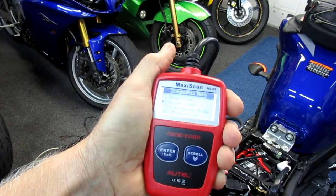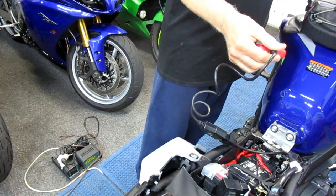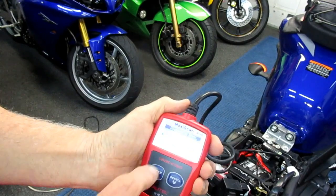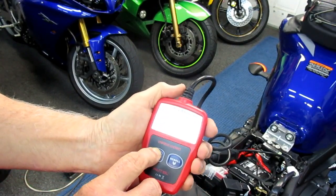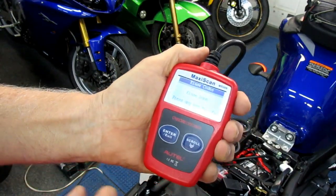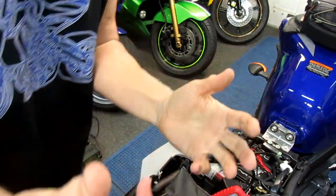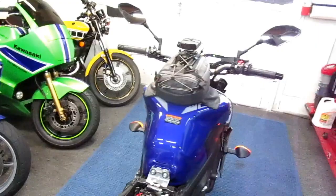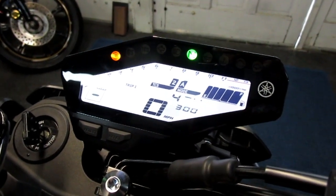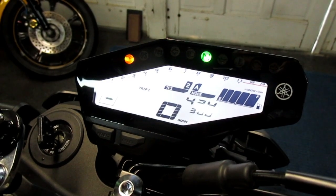Turn key on with engine off. I turned the key off, turned it back on. Erase codes. Erase trouble codes. Are you sure? Yes. Erase. Done — press any key. I want to do this without a camera cut. If you look right now, that was a real-life, real-time turn of the check engine light off. I did it on the fly without really knowing how to do it. I've tried to pass on everything that's useful. I think you should be able to do it too without any problem.